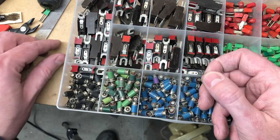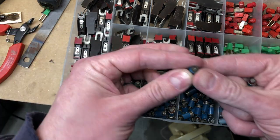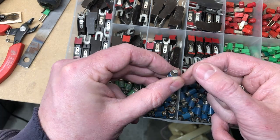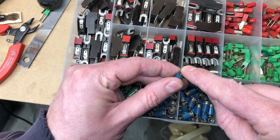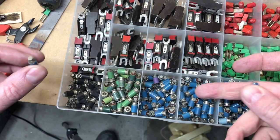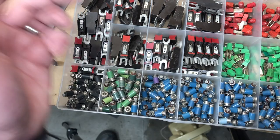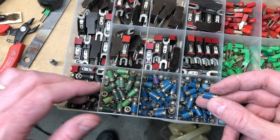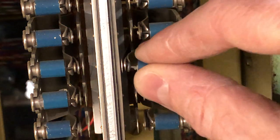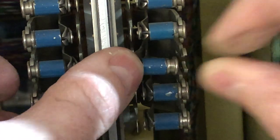But apparently what you can do is: take the heat coil, take the little spring-tension peg, and take a soldering iron and press it on there and wait, and it'll eventually stick back in. You have then fixed the heat coil, ready for use again. That's what I intend to do, because they aren't making this stuff anymore. So let's go put this in.